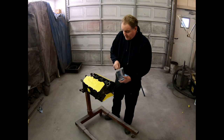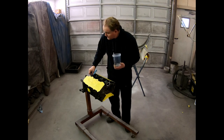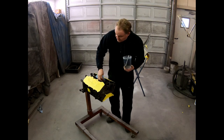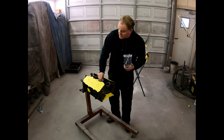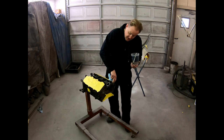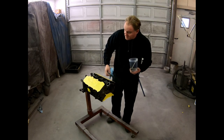Now this block has already been cooked and cleaned at a machine shop when it was bored and honed out for the new pistons. They're 88 millimeter forged, basically 40 over. All the rest of the little parts, like piston squirters — which throw oil up onto the underside of the pistons to keep them cooler — they're all soaking in a carburetor cleaning bath to make sure I've got any residual oils out of the system, because I'm pretty sure they didn't get cooked with the block.